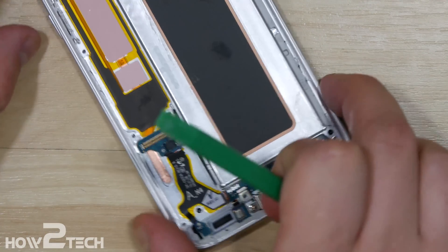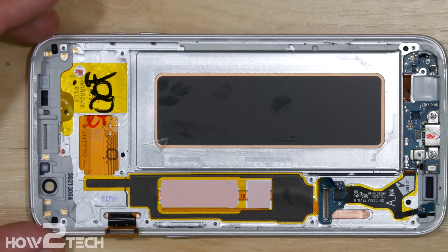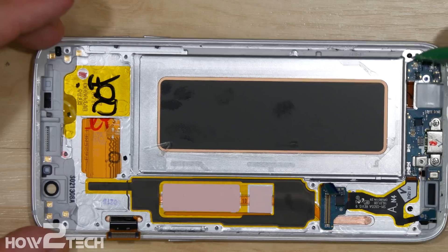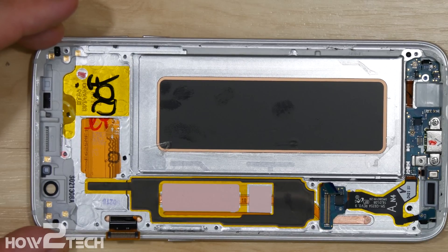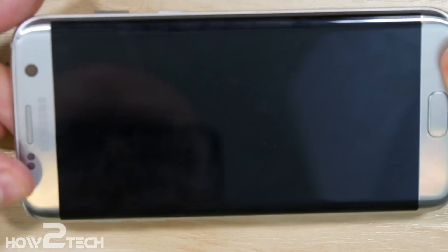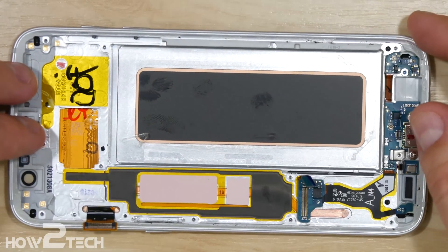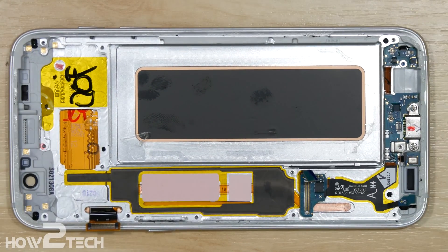That's really as far as we can go on this particular phone. The charge port cable is wrapped around underneath the display on the front, so to replace your charge port you're going to have to remove the screen. Being an edge phone, I'm not going to do that because it's almost impossible to remove these edge screens without damaging them. So hopefully you can find a whole assembly and just put all the pieces back in. I'll go ahead and show a reassembly video — I'll link the short video in the description as well. Anyway, thanks for watching, catch you in the next one.